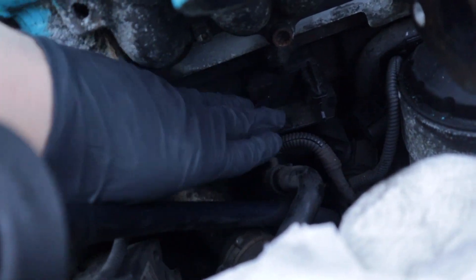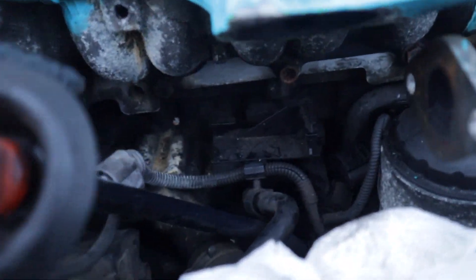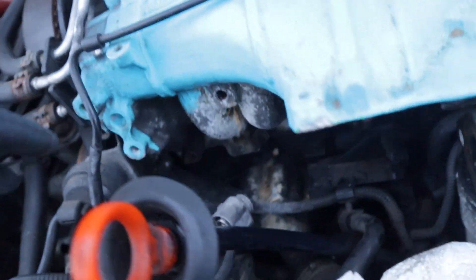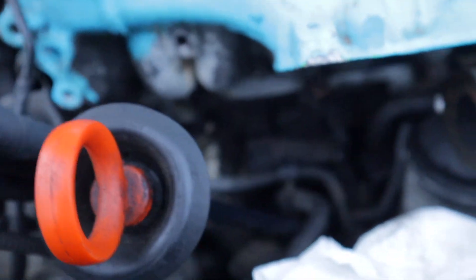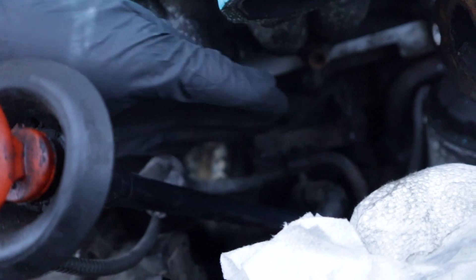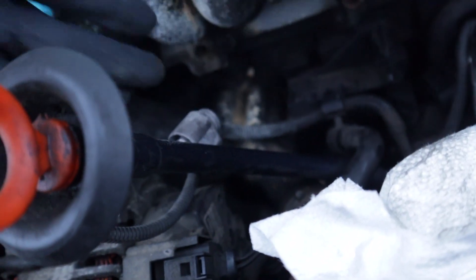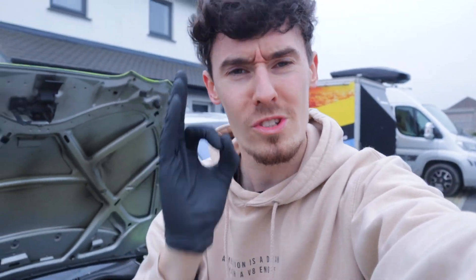The throttle body was massively in the way. I actually managed to do it without taking it out, but afterwards dad took it out just to make it easier to put back. When you change this sensor it unplugs here, and there's also a sensor down here that you need to pull through a hole about that big. I didn't know that, so I'm sat there faffing for ages asking my dad how it comes out. He goes, 'it must come out.' So I cut it — mistake number one — and found out that to replace that sensor you have to take off the cam belt. What an awful design.